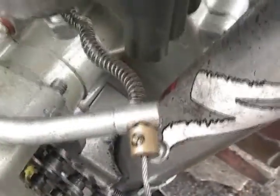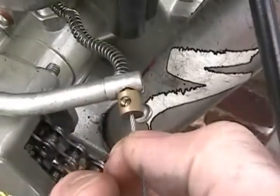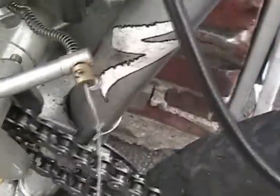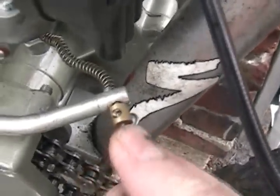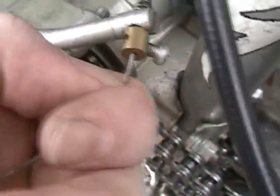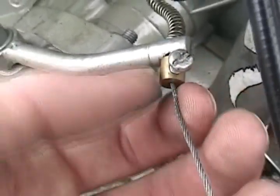My recommendation when attaching the clutch cable: put a pinch on the cable with a vice grip to have a connection you can pull on real tight. I pushed in on the clutch arm with one hand while holding the vice grip with the same hand to keep the cable pulled tight. Then with the other hand, twist down the screw to hold that cable in place. You've got to pull the line tight, push in on the clutch handle, and then tighten the screw.